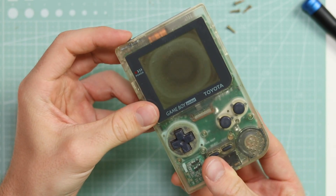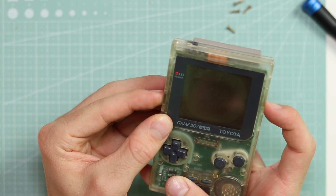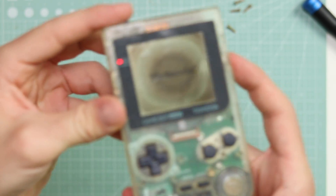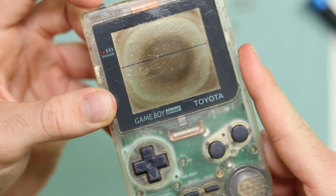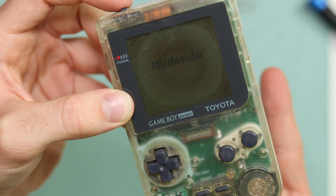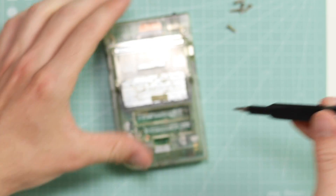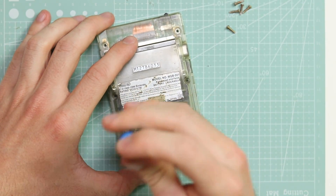There we go — it does work! The image of the Nintendo logo is corrupt because the pins obviously need a good clean, and it did take a while to turn on. If you move the batteries around it will be a bit hit and miss, so it clearly needs a good clean and obviously the screen replaced. Very relieving, because the motherboard had a good chance of being quite damaged there with the corrosion in the battery terminal, which I will show you in just a moment.